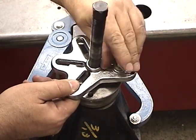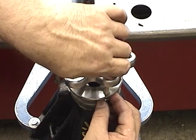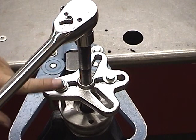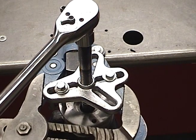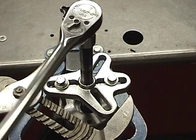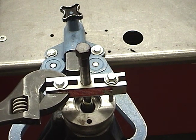This tool needs the use of additional bolts. As you tighten up on the forcing screw, the flange will want to spin. If it's real tough to come off, it may be hard to hold it from spinning. If that's the case, use a large pair of channel locks. You can grab a hold of the puller tool to pull it off. If you're using a two-jaw puller, you can use channel locks or an adjustable wrench to hold it in place.